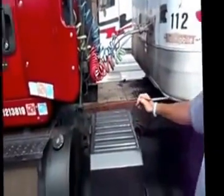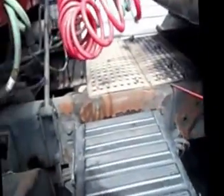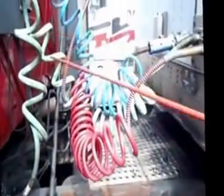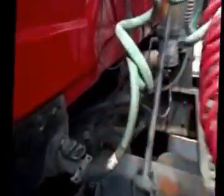I'm going to check my frame. Make sure the frame is not cracked, bent, or broken. No unauthorized welds or drill holes. Okay. Check my electrical line. Make sure it's not frayed or cut. Both safety latches are over each end of the electrical cord, here and here.